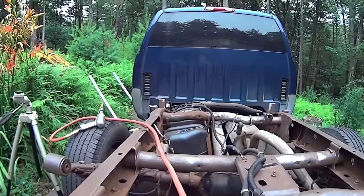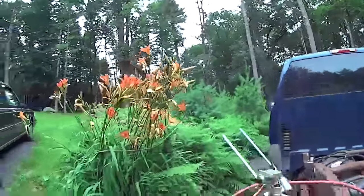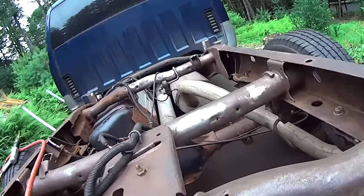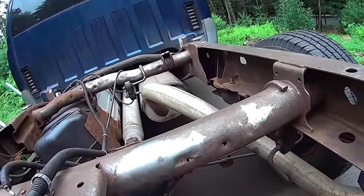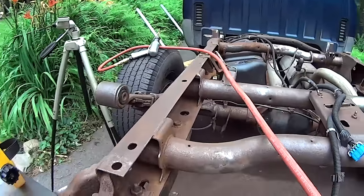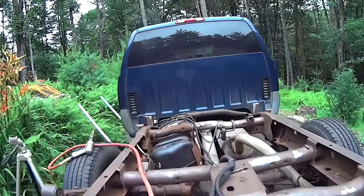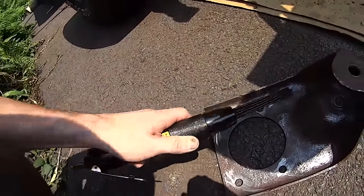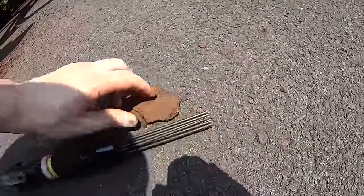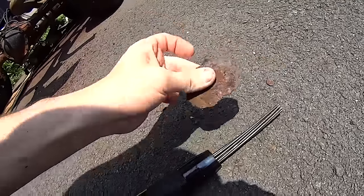The only weak spot on the tubes is right here — my air chisel almost went through. That's another beauty of using this air hammer: it basically finds every weak spot. You're not kidding yourself. A lot of people try to fix rust without touching anything so it doesn't break through, but with a frame you want to find those weak spots. This tool will punch right through, which is what you want — solid metal or nothing. You can also use a needle scaler like this one to get into tight spaces, but it's slow going for heavy scale rust — it breaks little piece by piece and takes hours, though it's good for tight spots.